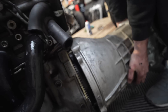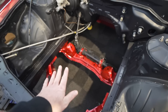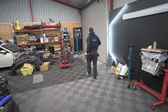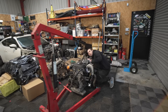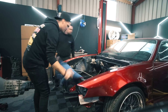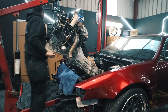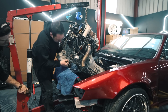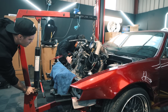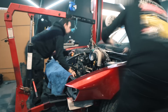It's gonna slip straight on now. It had the bolt at the bottom, didn't it? No, it was actually a nut. So you may be thinking that it would be easier just to put the engine in by itself and the gearbox in afterwards. But because this is an R154 gearbox and the car still has a standard tunnel, it actually makes it pretty tricky to get the gearbox in separately. So whilst we had the opportunity, we decided to throw them in at the same time, making it a much easier job in the long run.